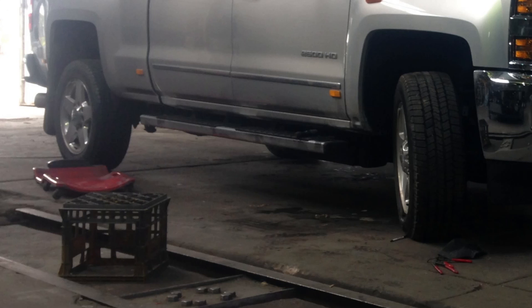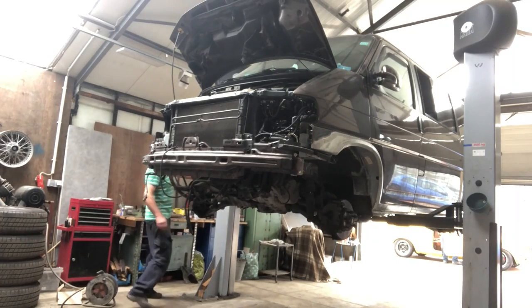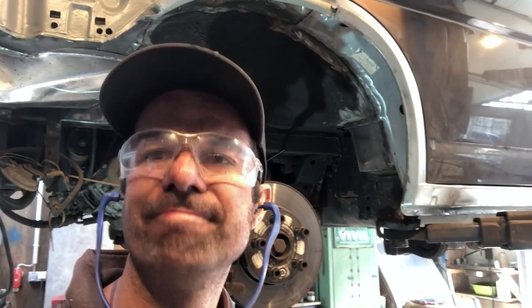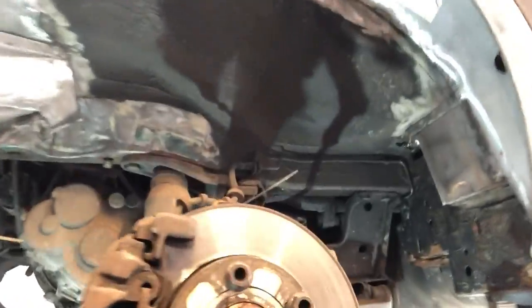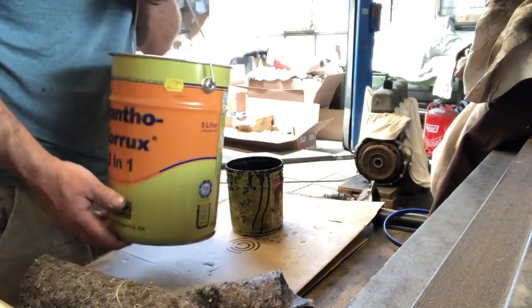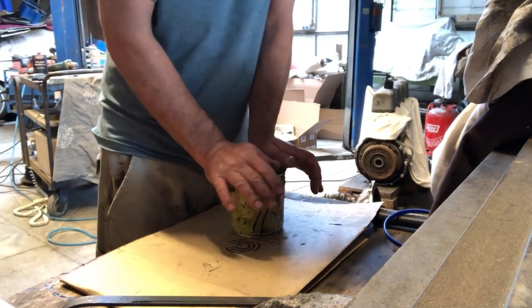The humble milk crate has thousands of uses — stabilization, propping, elevation, scientific and durability testing, just to mention a few. Up on the hoist for the first time in a while to get it ready to paint underneath — but watch this, there's a spot I've missed and there's another bloody hole. Out with the welder and the wire wheel before the paint can go on. Another day or two or three later of cleaning and welding and finalizing little details under the bus, I was finally ready to paint.